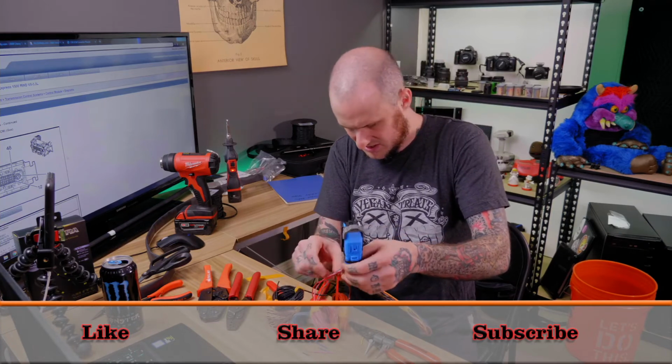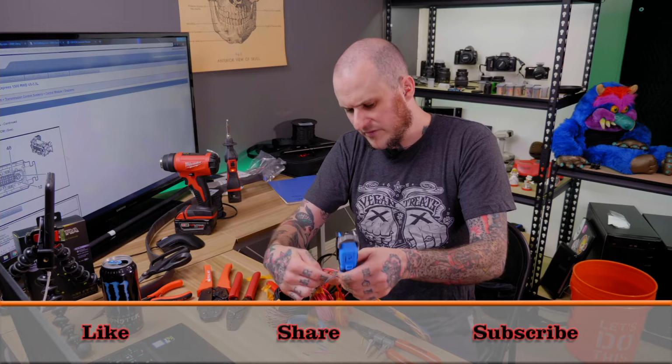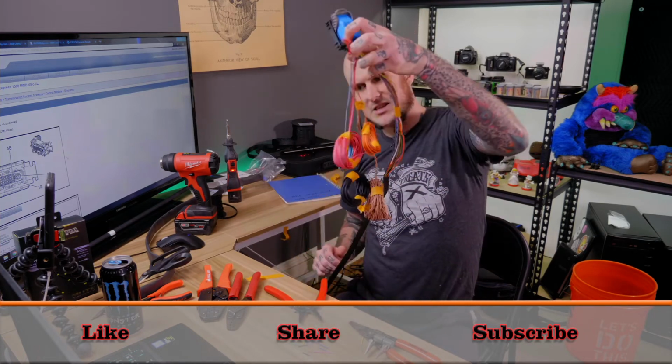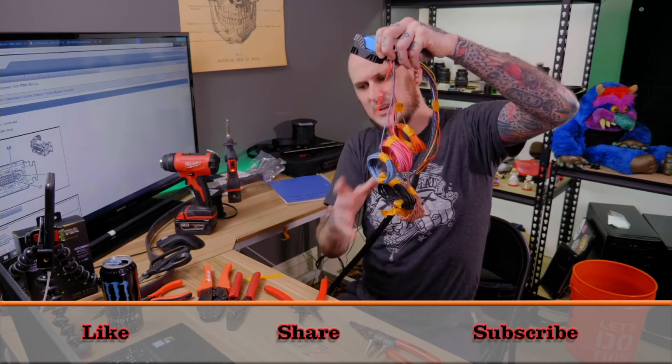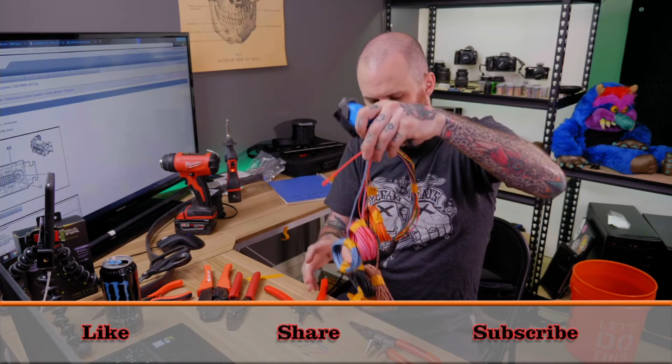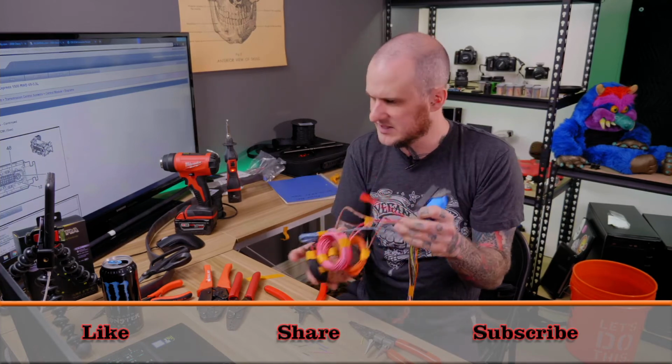Let me get this. I've got these 6 wires back here that I just remembered, so I've got them just kind of tied off here and separated. These are the 6 wires that go from the transmission harness to the engine harness. So I need to put a Deutsch connector on these.